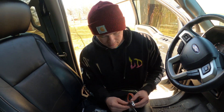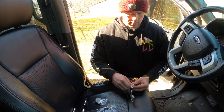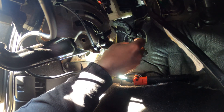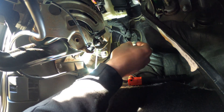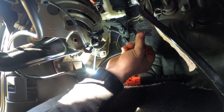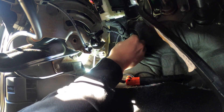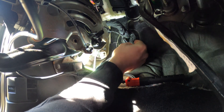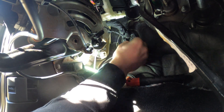Now I want to start showing the steps to get it into the truck. We're underneath the brake pedal here, right where it goes into this big rubber grommet — where all your wires from your dash go into the engine bay. You can take a razor blade and just cut a small incision into the boot. You don't want to go deep, just get through it.